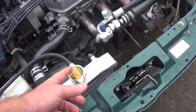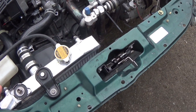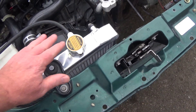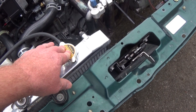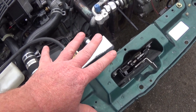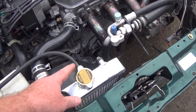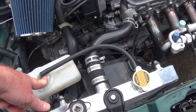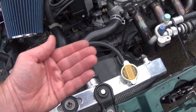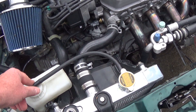Usually what you do is you open the lid, you watch it, and as it bubbles down you keep adding fluid. But there's another method: if you take the cap apart and just leave the top seal, then pressure is not a factor. You don't have to hit 16 psi for this to open or close. As it boils up a little — usually you get air pockets pushing the fluid up — it'll push excess fluid in so it won't overflow. And as it starts going down, instead of adding fluid all the time, it'll suck it back in. So you can probably drive around a little bit like that.